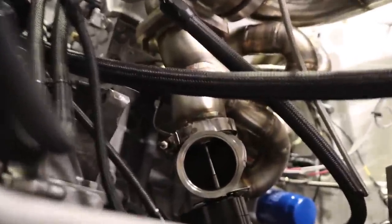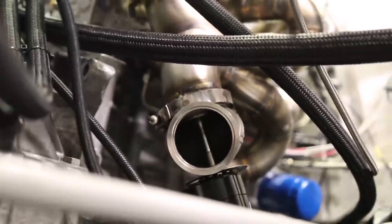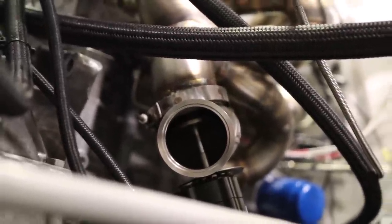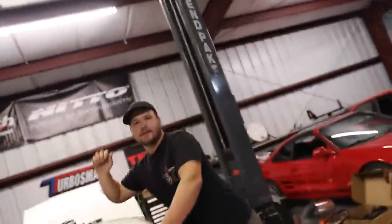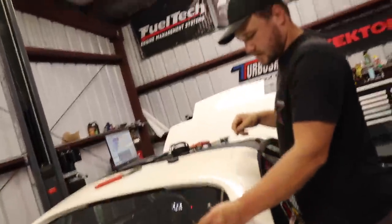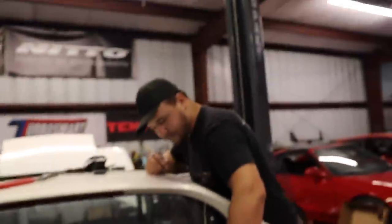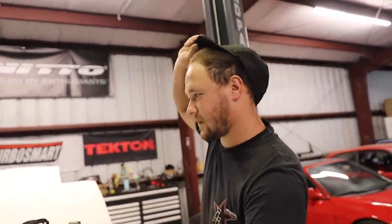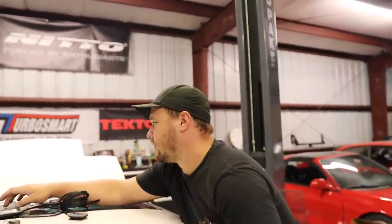The wastegate is opening and closing — it's operating. It doesn't appear to move a huge amount, but that may be all it needs to move. They note it's going from 0.5 all the way to 4.5 volts, which they assume is its full range. It won't show the percentage open yet, and it's reporting 302 degrees — so it just needs a little scaling and setup configuration. They'll need to get a hold of Anders to get it dialed in properly.